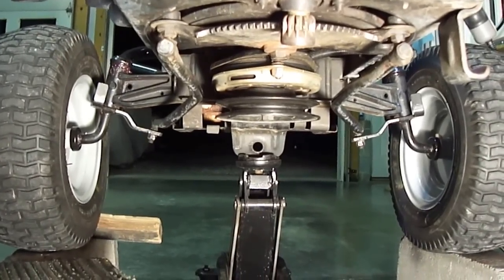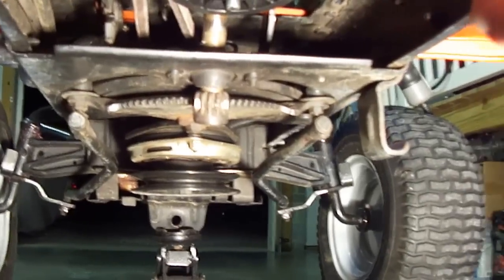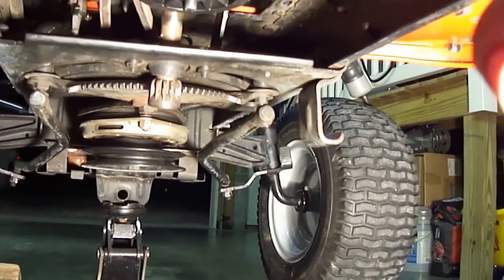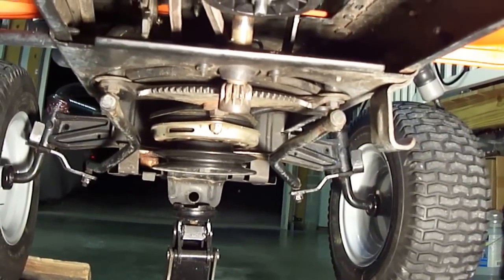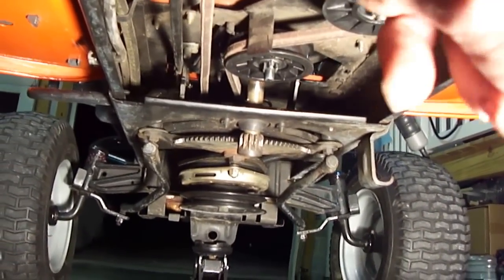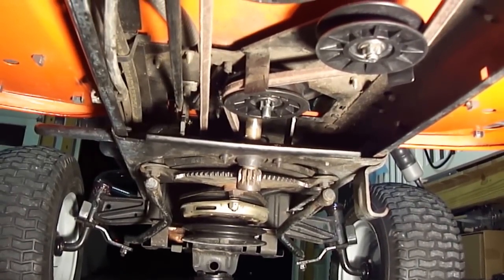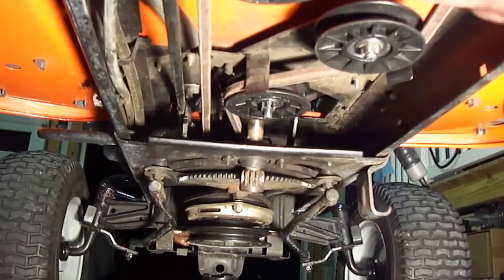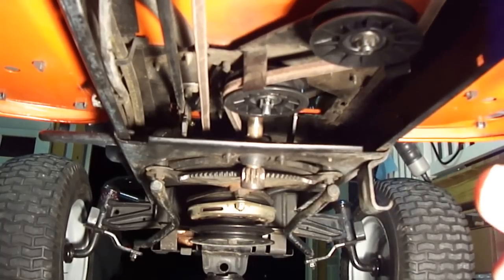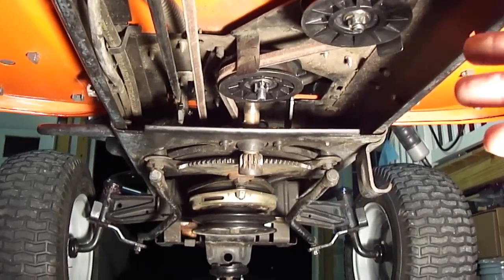It saves time. And just feed the belt basically back through this little serpentine setup here, and I didn't actually hook the belt around this single pulley to the left in the back. I went ahead and looped the belt around the fan and the pulley in the rear, and those blades on the fan are really flexible, so I wouldn't go pushing on them mega hard, but you can get the belt around it.